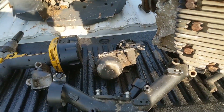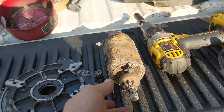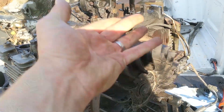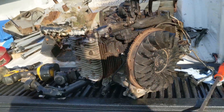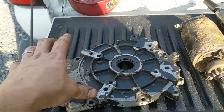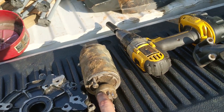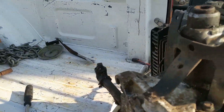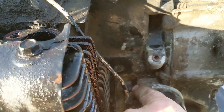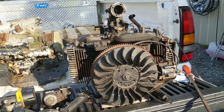We got some of the pieces here already and I got a few on order. We got the oil fill, the intake manifold, starter — somebody robbed the starter off this, it was a junkyard engine — but it's free, it has good compression on either cylinder. Got the front cover; this starter I had laying around has got a bad Bendix, so I've got to wait for the Bendix to show up, and I'm waiting for the correct dipstick. We'll have to drill out that boss down in there. As soon as the parts get here, I'll get started on this, so stay tuned.